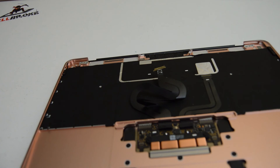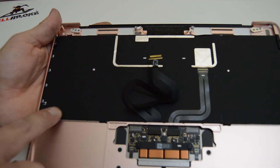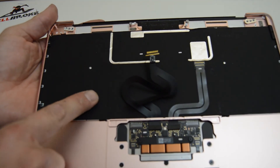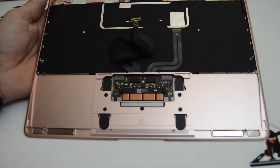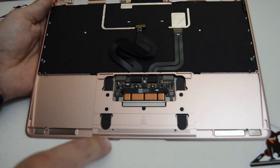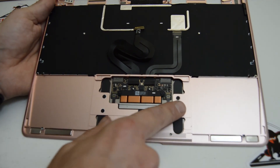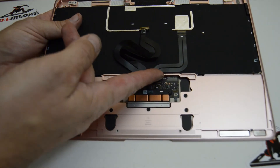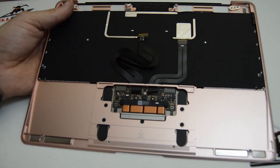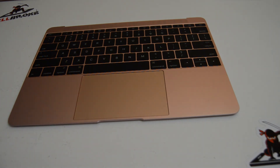There's our top case assembly. The keyboard is usually going to have a ton of tiny little Phillips — or possibly Torx — screws holding it together. Unless you're a Mac repair technician, you definitely don't want to be messing with trying to get this keyboard on and off — it's just horrible. For the touch pad, remove all these Torx screws — I think these look like a T5 — and make sure the ribbons are disconnected before you try to pull it out, or you're going to pull on them. Once you're in, you can replace your touch pad quite easily. That's how you take apart a MacBook 12-inch A1534 rose gold — it's the same for all the other colors. If you found the video informative or you liked it, please like and subscribe.